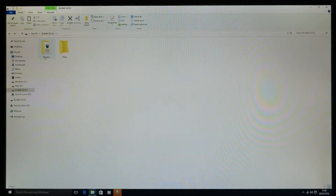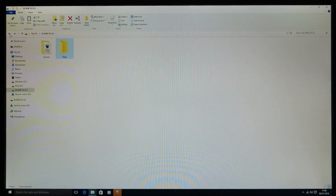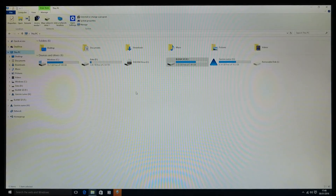What you're left with on the SD card now is a Garmin folder and a Map folder. The Garmin folder should have the JCV folder if you've got junction view — if not, it'll only have the garmin_device.xml. In the Map folder you should have either three or four, but definitely three, gmap_prom files. If that's all in order, you've transferred everything you need onto that SD card. Take the SD card out, unplug the Zumo, and put the SD card into your Zumo.